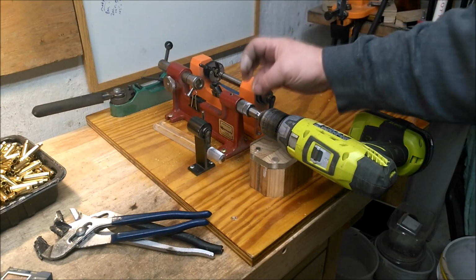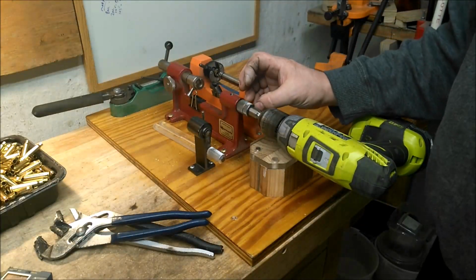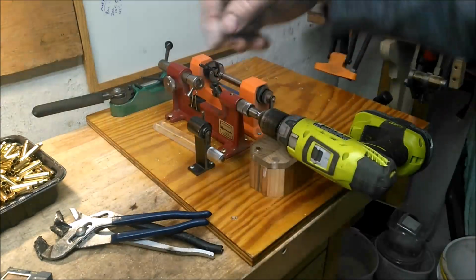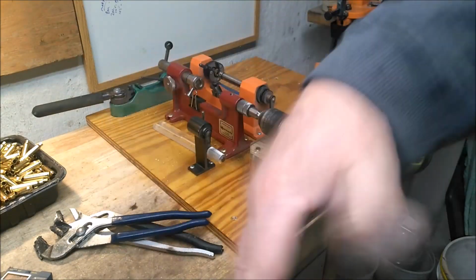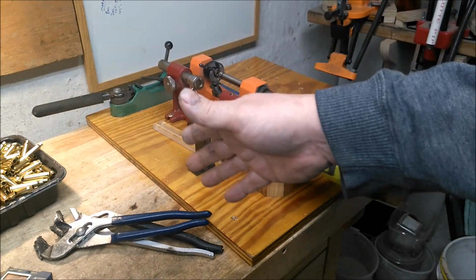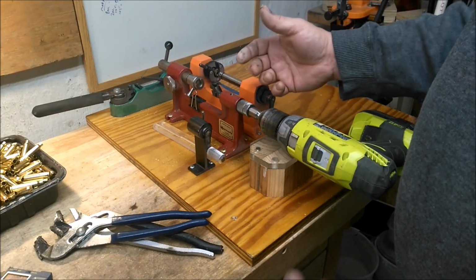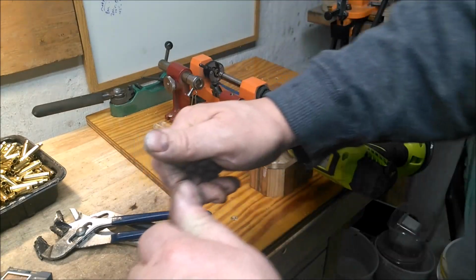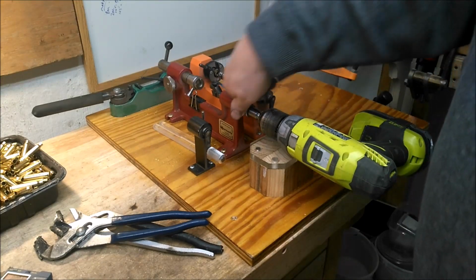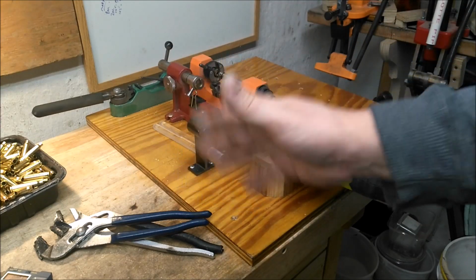So that O-ring is supposed to keep them from rotating, but if there's not enough friction against the threads, they'll rotate in unison, as a unit, and that's what happens. So doing that, I was able to get it much tighter than with my bare hands, which I had tried. I cleaned everything up, tightened it up as much as I possibly could with my hands, and I was able to turn it, grip here, turn it without excessive amounts of force. Let's put it that way.